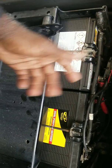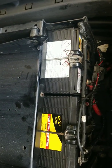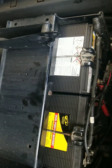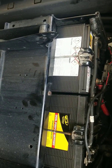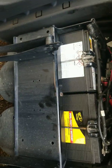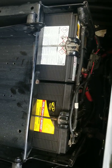Just like this battery now, this drop in charge, the APU was coming on. So now I realize, okay, that's the signal it gives me, that the batteries are going dead. The APU will keep coming on because the batteries are dropping. So usually the case is starter, batteries, then alternator. So now the next thing will be the alternator that needs to be replaced.